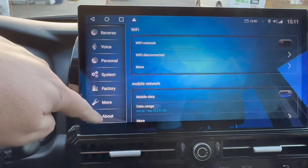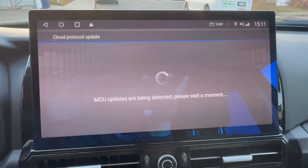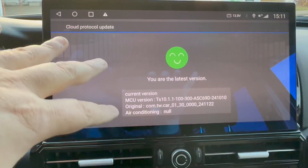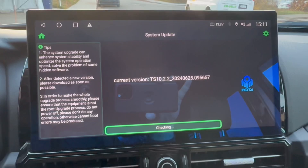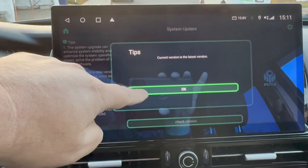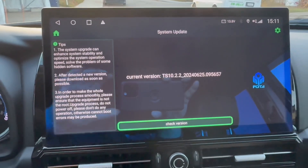If you do not have internet, the MCU is not going to work or it's going to malfunction. Let's do this again — go to 'About,' then 'Detect Update.' That's for the MCU. If you're at the latest, it's going to tell you you're at the latest. Now, sometimes the system update also tells you — once in a blue moon, once or twice a year, or whenever crucial updates are available — it is going to prompt you to do the update. It takes longer than the MCU update. That's how you do the MCU update — love you all.